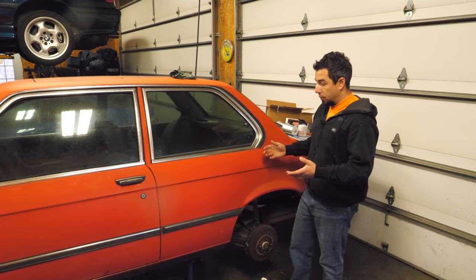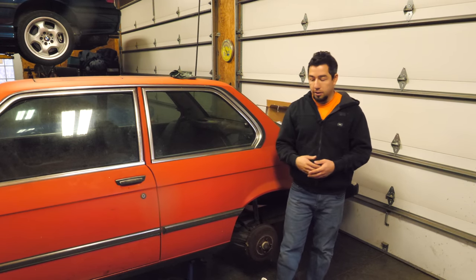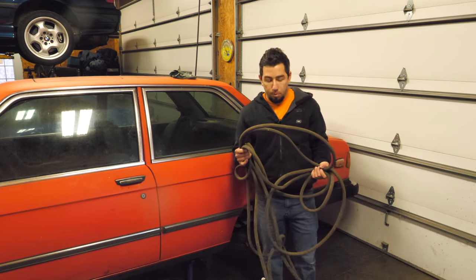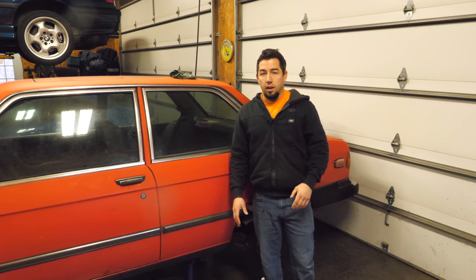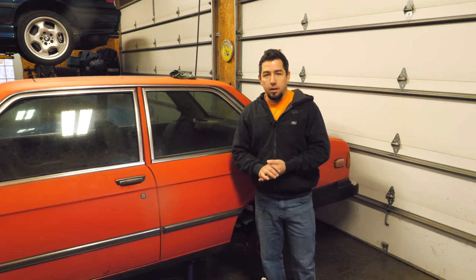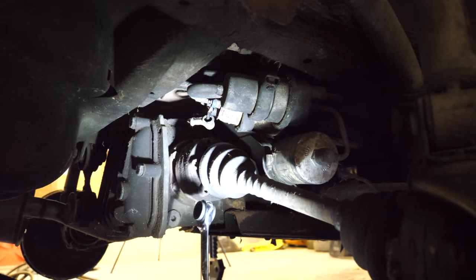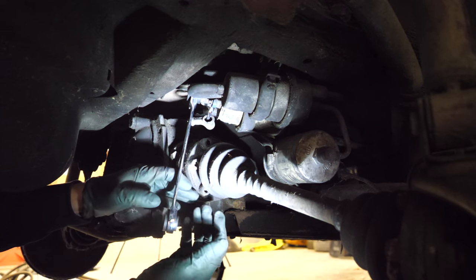There are a few different ways to evacuate old gas from a fuel tank. I like to use the pump on fuel-injected cars to pull all the old gas out, especially since we're replacing this fuel pump anyway. To do that, I'm going to connect this long hose — it's old air hose from my compressor that got damaged. It's oil resistant and the right size. I should be able to put it on the outlet of the pump and get all the fuel out of the tank. I'm going to use my jump box, separate the wiring from the vehicle, and get that old gas out.